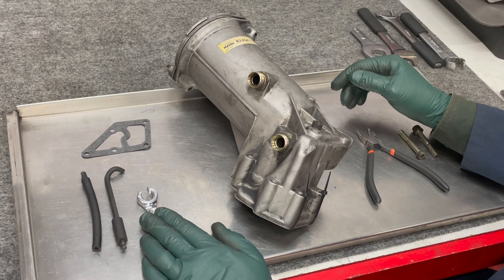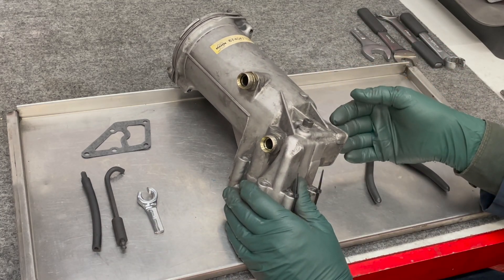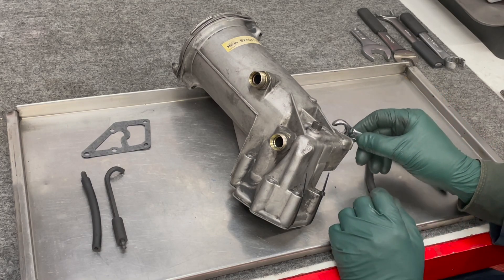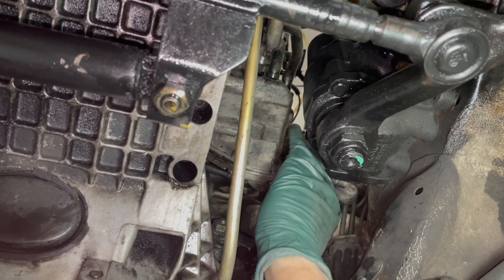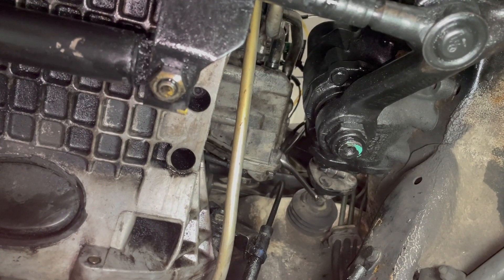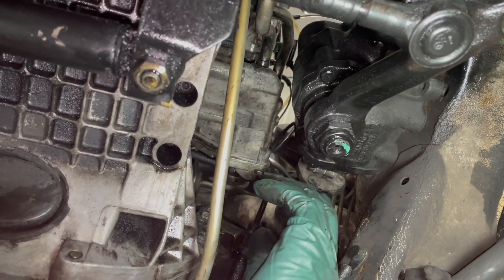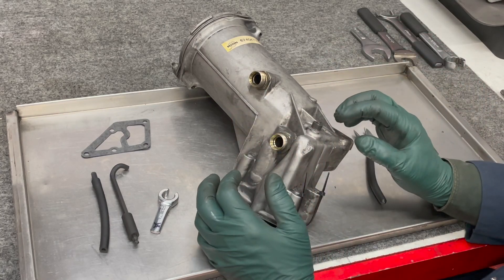It's really hard to get that oil pressure line off the back side of this plate. What this b-nut wrench will allow you to do — and the fact that it's a b-nut wrench will keep from rounding off the edges of that nut — is you get underneath the car, get this on that nut, and you've got the plastic line coming up through the firewall. Even though it's real short, you can pry against it or tap on it to get it loose. With a long wrench you'd run into either the steering box or the subframe.